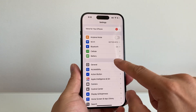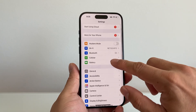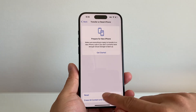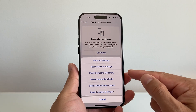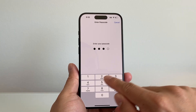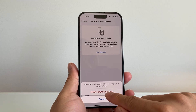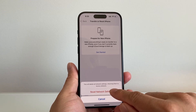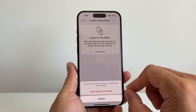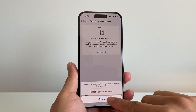If you don't get a pop-up, let's move on to the next troubleshooting step. This time in Settings, go to General and then scroll down to Transfer Reset. Click on Reset and do a network reset. What a network reset does — go ahead and enter the phone's passcode — it basically resets the network settings to default settings, like saved Wi-Fi, your Bluetooth connected devices, and your cellular settings as well. Important step to do. This will not delete any of your data, so all of your photos, videos, and apps will still be on your phone.